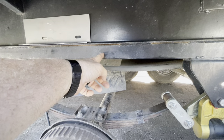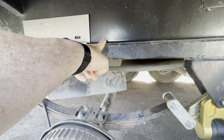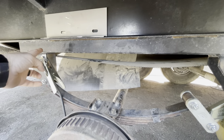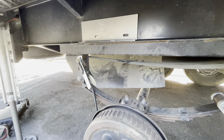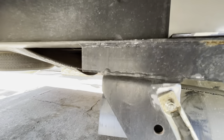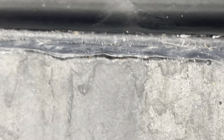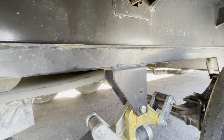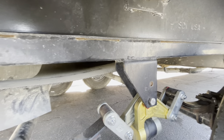When you're down here looking for frame cracks, you want to look anywhere near your hangers. This one happens to be a box tube on top of the I-beam, so we're looking for cracks in the I-beams themselves that are near the hangers. And on this one, it looks like we have a crack back here — yep, we sure do. So the actual box tube looks like it's got a crack in it as well.